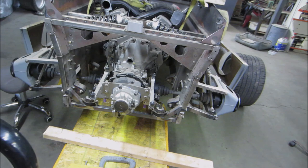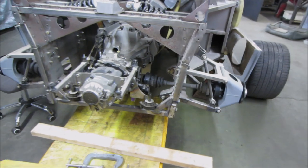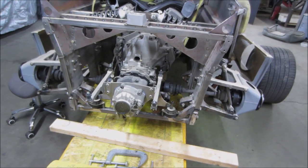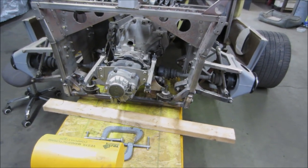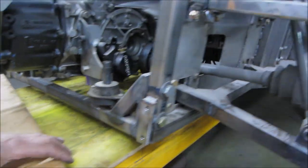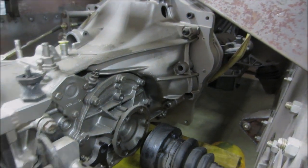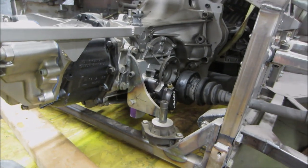Anyway, come in right about there, we jack that up, and we could probably make a couple of pieces of wood for the forward part of it. The back, we're probably going to catch it right on that cage. We might even cut a 2x4 for right in here. We'll let it sit on there. And what we got in the front? I'm going to go crawl under there. I'll measure a distance. We'll try to make a block of wood for the front of that too. So this will keep it from tipping the back side of it. In the front, we just need the support.